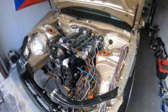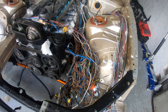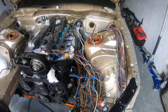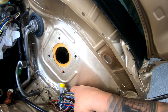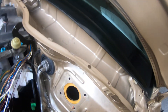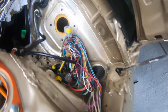I know it looks like a huge mess right now, but I pretty much know where everything goes. I've labeled everything, so I know where they're all connected to. I haven't spliced or cut anything other than removing the whole ABS traction and VSC system, which is on the other harness. I also have some wiring I'm going to be removing: the daytime running light system, the washer jar pumps, and the wiper motors — I don't have wiper motors or anything, so I'm not using that. Those wires in this area are ones I'll be removing in another section.